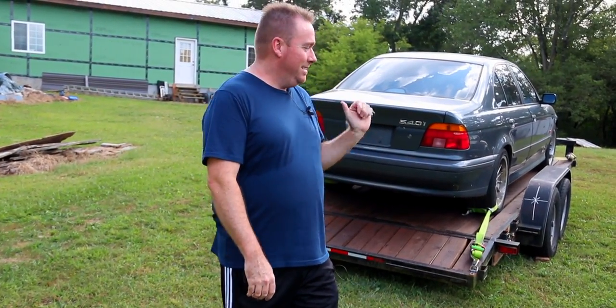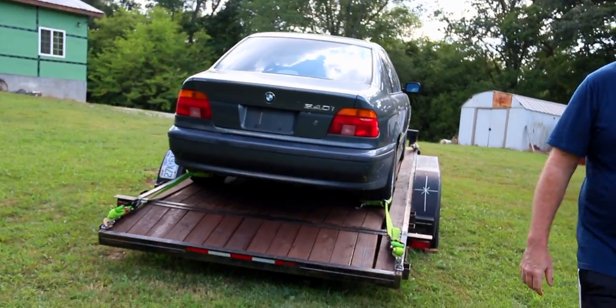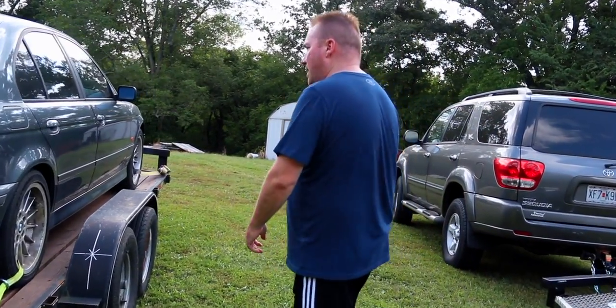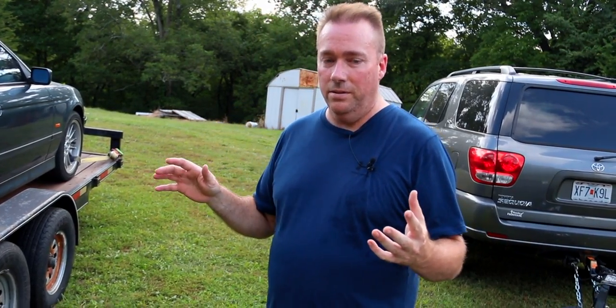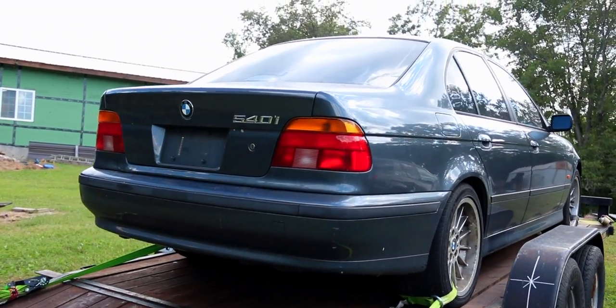The old trailer is an 18-foot wooden floor, and we noticed 18 foot is not quite big enough for a lot of bigger cars. Now a lot of you are saying, okay, there's a 540 on your trailer — what's the deal with that? The deal is the guy we sold the M5 to, this is his car. Without having to say it, you know what's wrong — it's a 540, 4.4-liter V8. The timing chain guides were destroyed in it. He went through and did the job himself. I have to commend him — he actually got it done. There's no check engine light or timing over-advanced, but he does have a couple of oil leaks. I want to check a few things on it to make sure he has everything done correctly, and there is a coolant line that's got a crack in it.